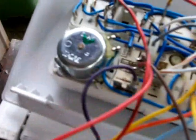Alright. Lid switch seems to be working. There's probably nothing wrong with this machine. So, let's see if we can work out. Let's just push this off. And we've got a yellow wire there and a red wire going out to the switch. That's just power. It's going to a capacitor. I wonder which the inlet would be. I'm not really sure. Hang on, it's these two.